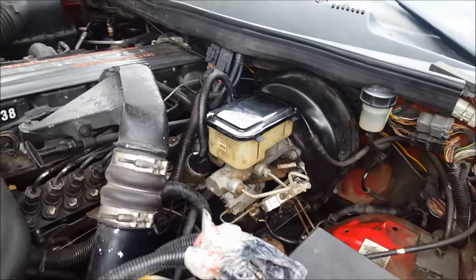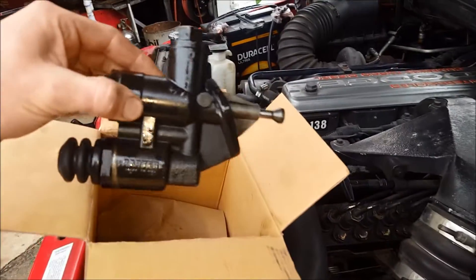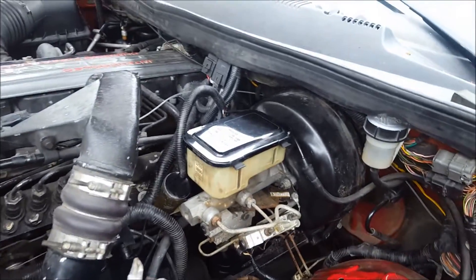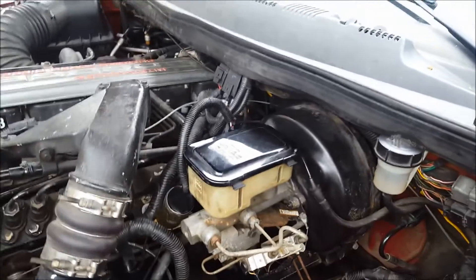With the new overflow valve, I'm still only getting 20 PSI. The stock lift pump is right here — I found one on eBay for $69. With 200,000 miles on this thing, I decided to put a new one on anyway, because it's obviously worn out or could be the problem.